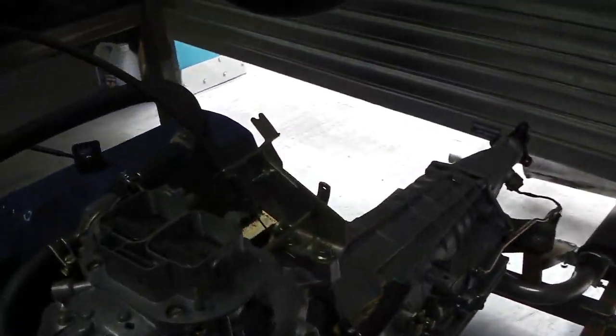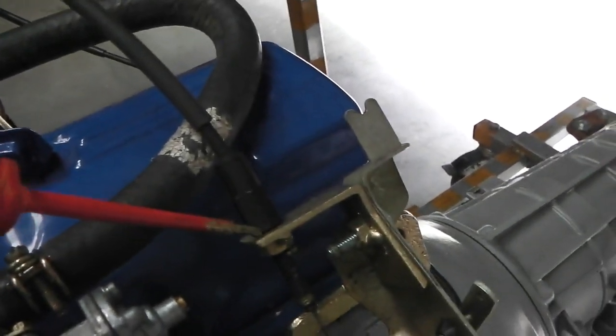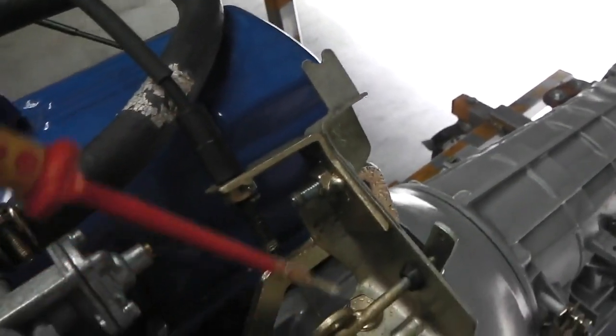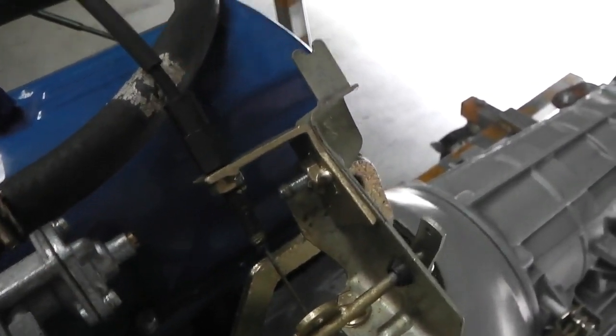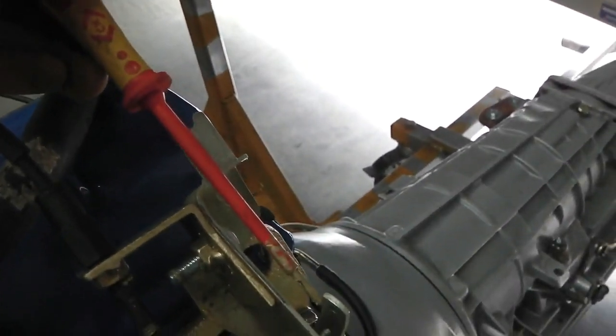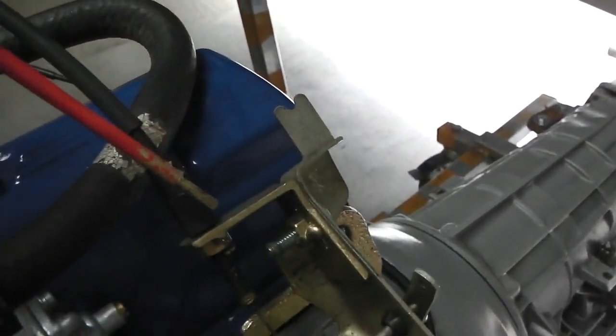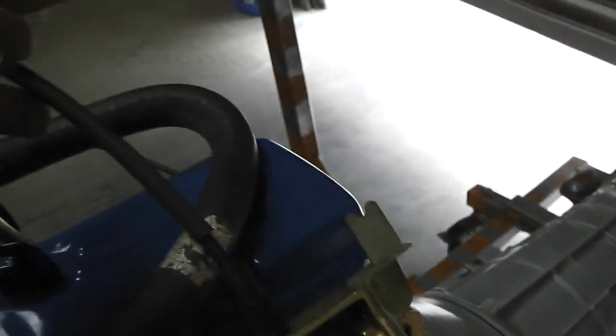Bellows there, connected. I'll just show you before we start. We had to bring in the accelerator, the throttle cable, cruise throttle cable, onto the main body. It wouldn't work by pulling the pedal accelerator, in other words pulling two. So there's your normal throttle, would be here for your rev, for your pedal, but it wouldn't do it. It wouldn't pull both cables. I had this cruise cable going inside the car. It's going to have to come into the engine bay.